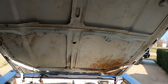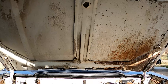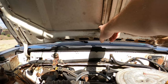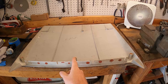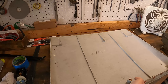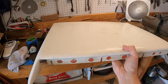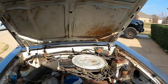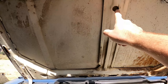The hood has some spots that look like factory provision locations. Since this is a factory '79 hood and that's a factory '79 scoop, there should be provisions on the hood for the scoop. I can see a section here that's most likely for the top stud and there's an offset indentation. The center line of the scoop is the stud right here, and going straight back you'll notice this is offset on the same side — as the scoop is installed, the offset is on the left side, off-center to the center of the hood, which matches this as well.